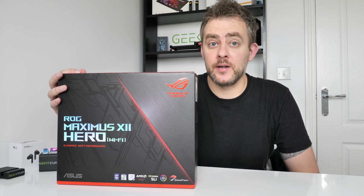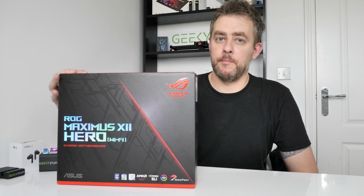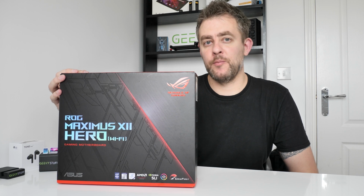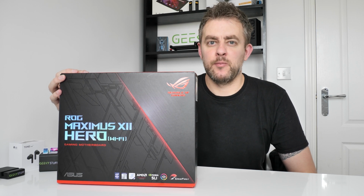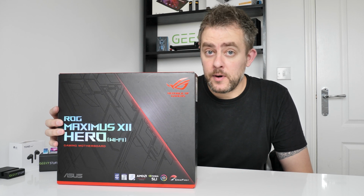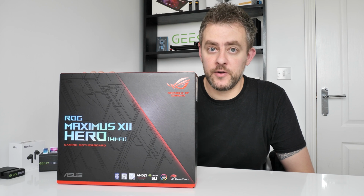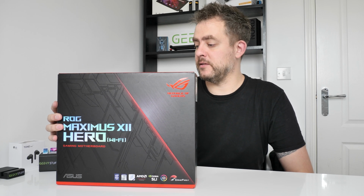So that's pretty much it, guys. I've showed you how to install a few components onto this monster of a motherboard and also placing the motherboard into an ATX PC. Pretty simple when you know how. I hope this video has been helpful. Just make sure you buy all the compatible parts. Obviously this is 10th generation now, so it won't fit some of the older processors.